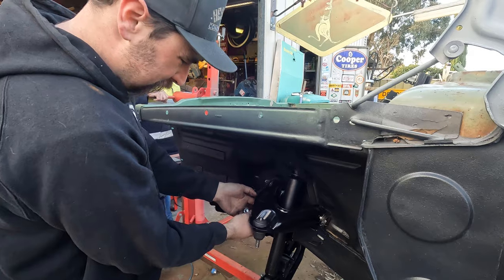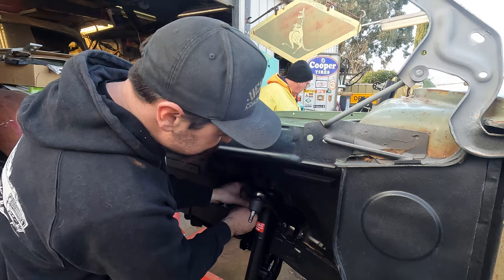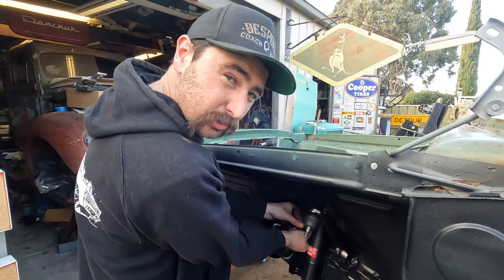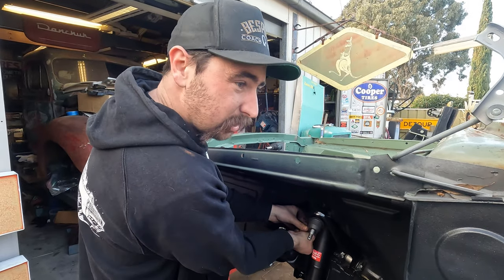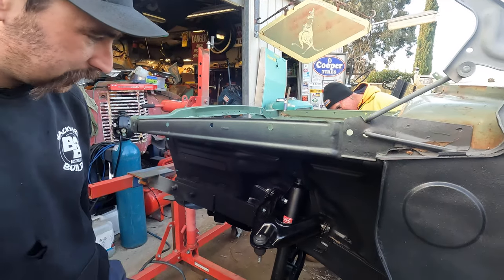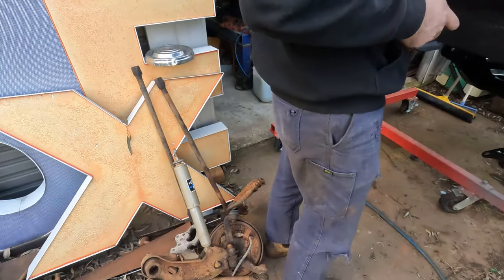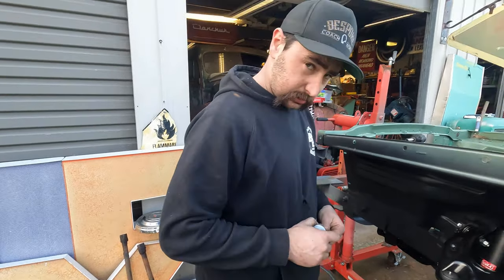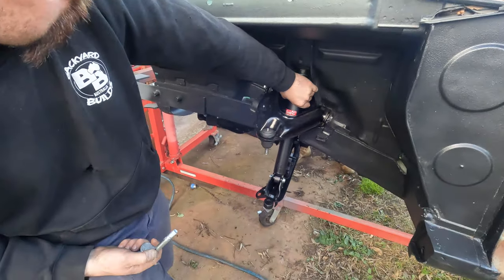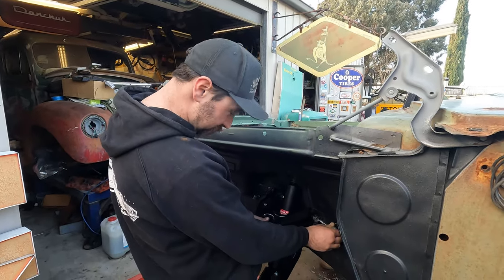Front end's almost in. Dad's done the other side. I found parts that I bought 18 months ago. What we're not going to do is tighten any of this up yet — not until the motor and box are in, or at least until it's on the ground. Those lower ones we can't do after the motor and box are in. Those shocks are still good — the old Monroe's. Off-market KYBs. Mate, they're expensive shocks. I bought them from Motorspares, and they bought them from eBay.